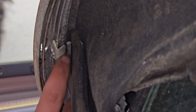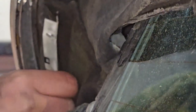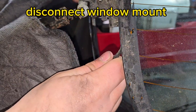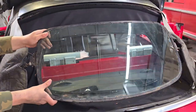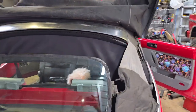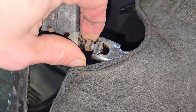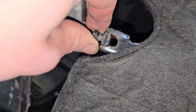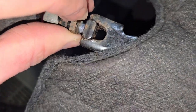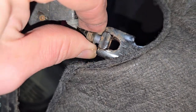There's also a middle fabric, so you've got the inner, a middle, and then the outer. Once you get all that taken apart, you need to disconnect the mount that holds the window itself in — just unscrew it. They were really stiff but not impossible. Putting them back on was much more difficult because you had to line it up with those fine threads.